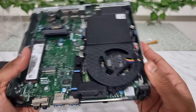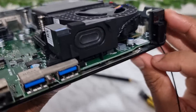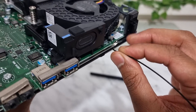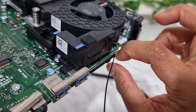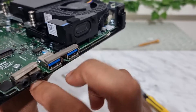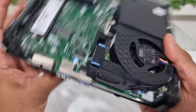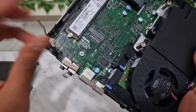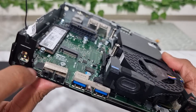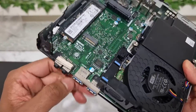If you don't have the screw, use two-sided tape to make sure the antenna is securely set. Now you have to be a little crafty — just under the motherboard there is a little opening in that metal bit. Push the wire through there; you might need to apply a bit of force with your nail or a flat-head screwdriver. The wire goes right under. Route it all the way through, and bring it out here. That's the internal antenna done.